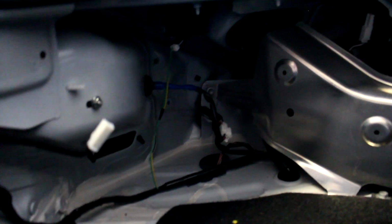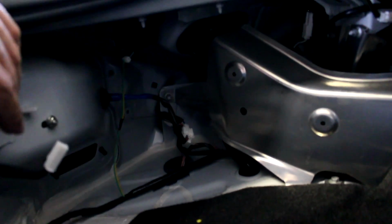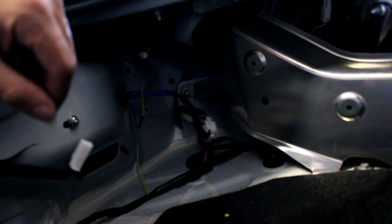Like, the video doesn't really actually do it any justice because it looks really cool in real life. So guys, if we now look at how the wiring is, so the original connector is right there, so this is the harness from the car. Then you have the little in-between harness in between there, and then here we have the rear light harness going to that plug. So it's all plug and play, as you can see. So now what I'm gonna do is actually I'm gonna zip tie this harness to this little supports so that it's all nice and plugged away.